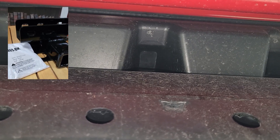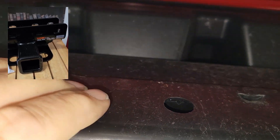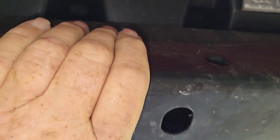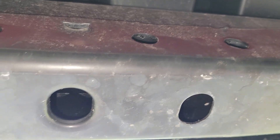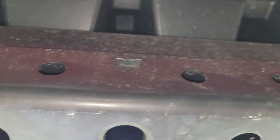The installation of the trailer hitch appears to be pretty straightforward. There are four holes in the frame — this is the muffler side and there's the bumper side. In theory, the hitch slides up over the frame and we put the bolts in from the back side going that way, with the nuts on the bumper side, so you don't have to take the bumper cover off.